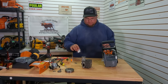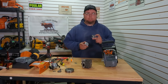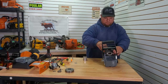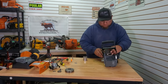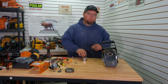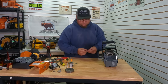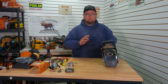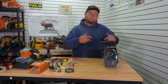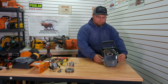All right, I got this cleaned up a little bit. This is the piston I want to use — a little bit shorter skirt, a little bit taller dome. This one's a dome setup versus the flat top. I'm just gonna hang it on here and see what it looks like, make sure it's not gonna free port real bad or anything. As it sits, that full kit on that piston was four grams lighter than the stock one. Now I'm playing with the piston — I want the piston as light as I can get it while still keeping some strength in it. 372 pistons are fairly heavy, but the lighter we can get it, the faster it can spool, the faster it can go up and down, and hopefully we can make more power. But if it's free porting super bad, we might not want that.